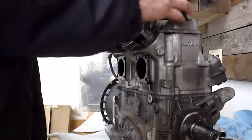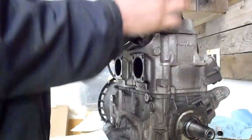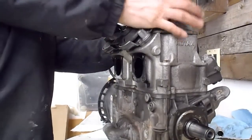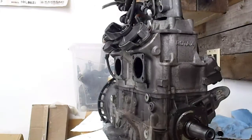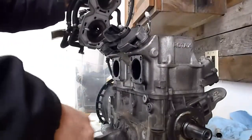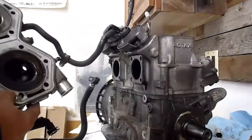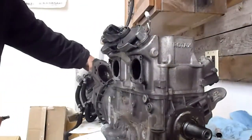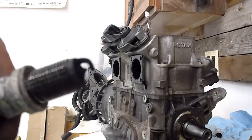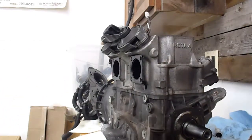I'm just going to take the head off. I'm not worried about taking the injectors out or anything at this point. I just want to take a look inside there and get possibly the monoblock off tonight. I'll take a look at the ports. There's a little bit of coolant laying around in there. Doesn't look bad. I have the plugs out already. I'm going to have to replace them obviously, but it looks like they're rich and there's a pretty darn good gap on them too. So I'm going to have to get some new plugs, gap them and index them. That's coming up.